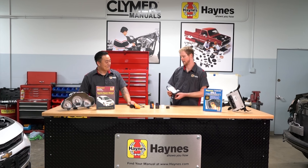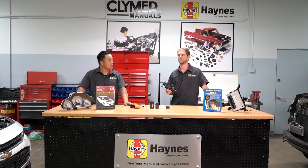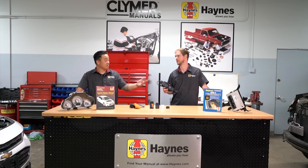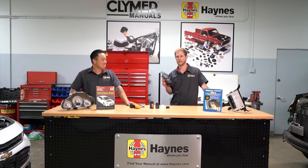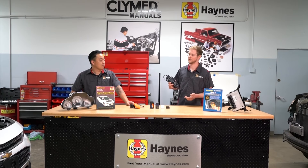What about that big one over there? So this is kind of an intermediate level scan tool — goes in the price range of about $100 to $300. These can do plenty of different functions: they can read your basic codes and more advanced codes. This one even does ABS and airbag codes that you can read and clear. And live features — live data allows you to actually view specific sensors in the engine as they're in operation, or even transmission fluid temperature, which many cars require you to know when checking fluid levels.